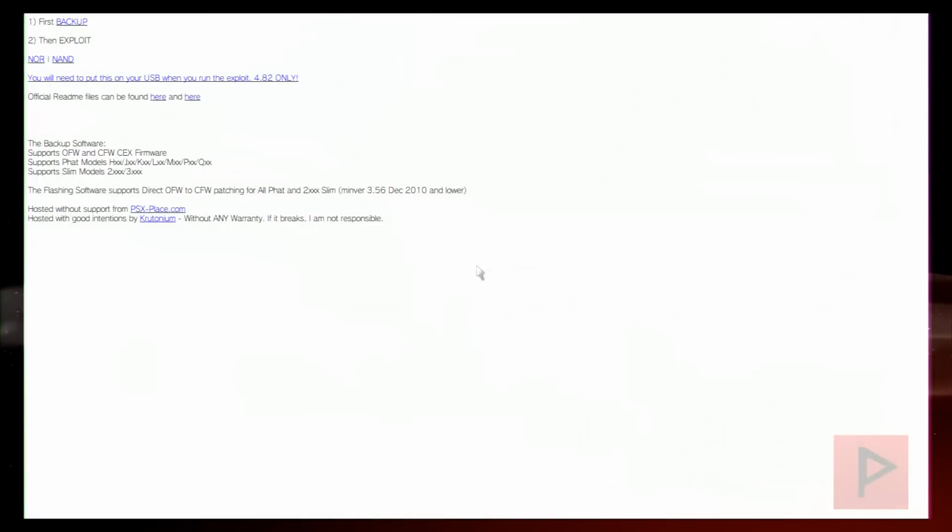Okay, so once you're at this particular page, next thing you want to know is, is your PS3 a NAND or a NOR? The majority of, all the PS3 Slims are NOR chips. Okay, if you have a Fat PS3, I think it's up to the letter H, I want to say, or maybe it's under H, that you are NAND. Anything higher, you are NOR. So if you do a quick Google search, and I'll have a link in the video description as well, you can easily find out if your PS3 Fat is a NAND or a NOR. All the Slims are NORs.